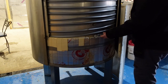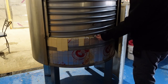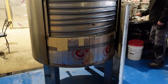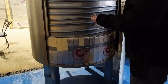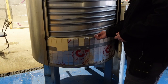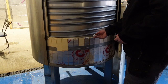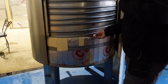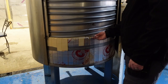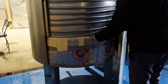Created another little problem but nothing insurmountable. Where I've cut that, I couldn't really get any closer to the bend because the copper went sort of stretched and thin, so it wouldn't have been the right diameter for the John Guest fitting. Additionally, the John Guest fittings aren't 10mm — they're 3/8. These are 10mm John Guest fittings, which would be perfect but it's too far to the right now. So I can't get the cover on unless I drill more holes. We need to cut this pipe again and extend it a little bit.